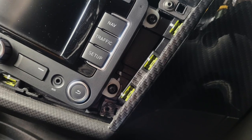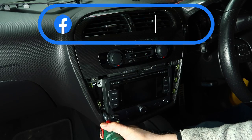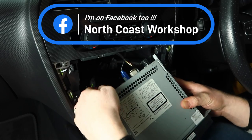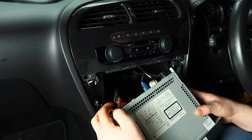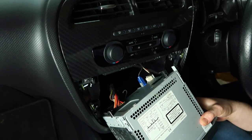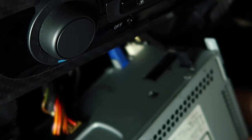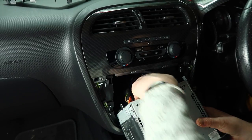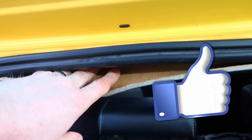You're looking to take out the four Torx screws holding the head unit in place. The wires never give much slack - it's just enough for you to get your hand in to take the connections off. I'll do a quick show of what the back of it looks like. It's the blue connector - that's the one for the GPS. The connector was fine, in place securely, and the one in the roof lining at the back of the car was fine as well.